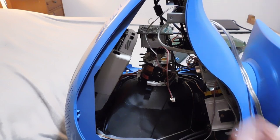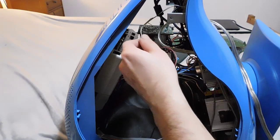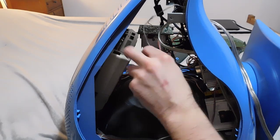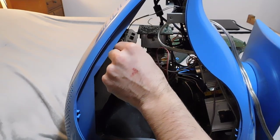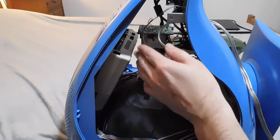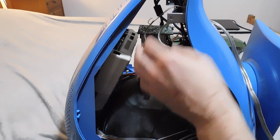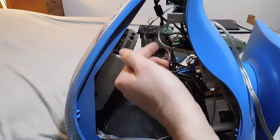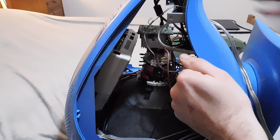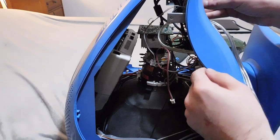Just one other thing to note, I found that basically it has extension cables. So for example, this is the modem extension cable, so that fits right into here and it just plugs in. So the modem just comes from here to a little port on the back of the television. The same is true for the AV port and for the serial port and the power. So all of that is just little extenders that go out from the Dreamcast to different places on the analog board or to this multi-out jack over here.